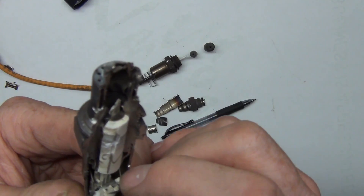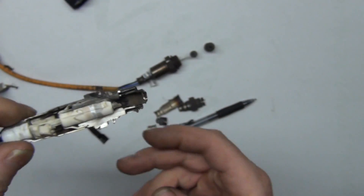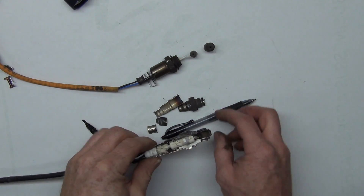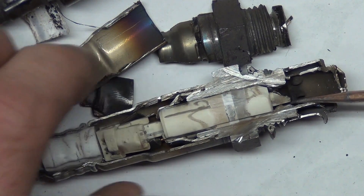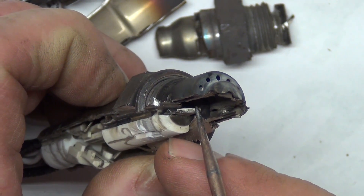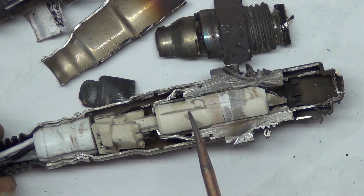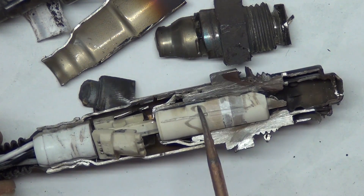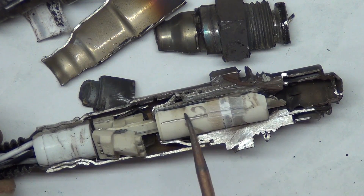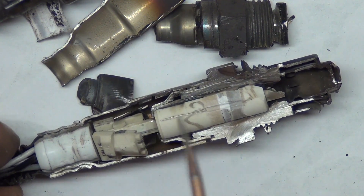But in this case I think it is the gray. When I was cutting it in half I got into the end of the sensor. In the diagram it shows a tube, but in this one it's more like a stick of gum — a ceramic version. As you can see where I cut into this, you can't really see a lot going on. I cut into another one as well. I tried cutting on it just to see what it would do because it had all these different colors, and when I cut through it, it's just layered — a bunch of different layers to the ceramic, I think just to enhance the properties of the ions and whatnot.